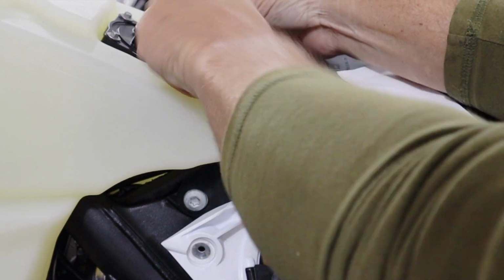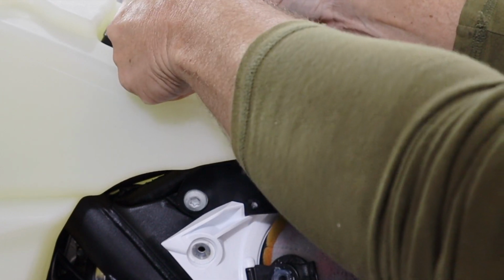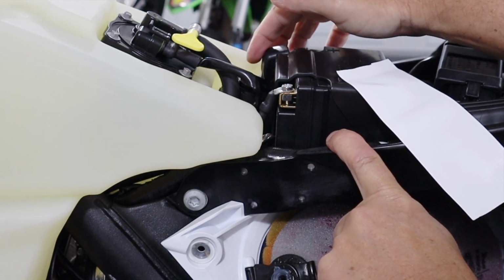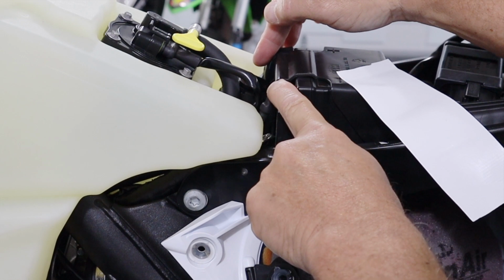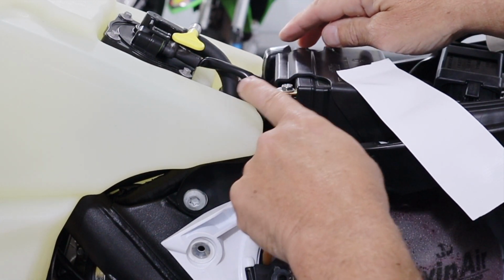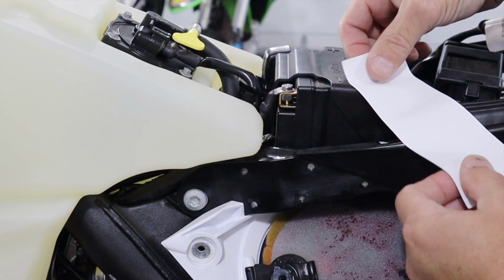One just smart, man. Little thing I got to tell you is, and this fits under the seat easy, right here. So this battery terminal cable, the positive, it likes to fall away. Here's your negative. There's zero cover on this thing. If you were monkeying around with this thing and something fell against these two things and arced up and you got gas fumes, it's disaster.